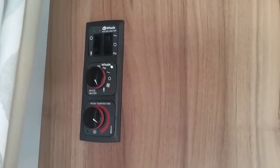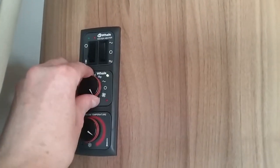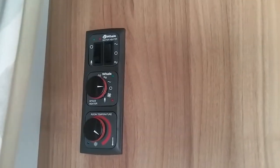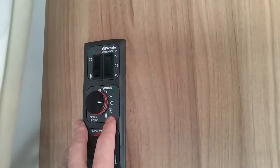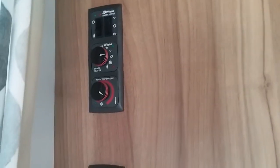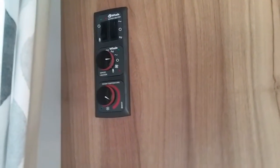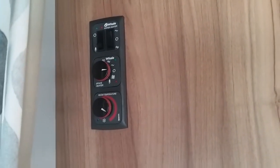And as you can see, it is now lit. To avoid the red flashing light coming on when you turn the unit off, always wait until the circulation fans have stopped before going to the main control panel and turning off the master switch. This allows it to go through its full cool down procedure, and that way it avoids throwing up an overheat code.